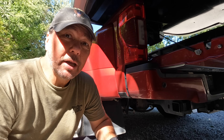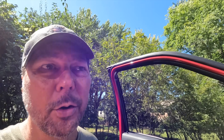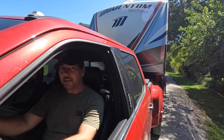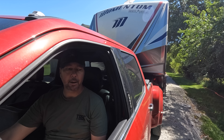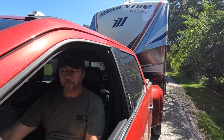I just checked and I did still get the trailer connected indicator in the truck, so I don't think it's disabling the brake controller or anything like that, but I'm still going to do a test. And because I got off and on the hitch, pull test again. While I've got this connected, let's just go ahead and do a light check as well. All right, the test succeeded. I'm really glad that test succeeded, because if it didn't, it would mean that those little tail light adapters for the braking system are disabling our brakes. So that's good — the adapters are working and not disabling our brakes.